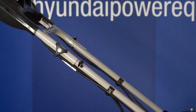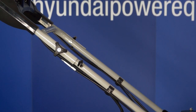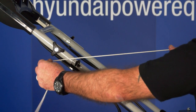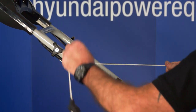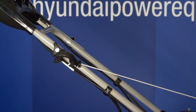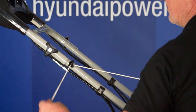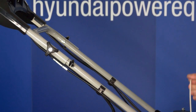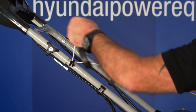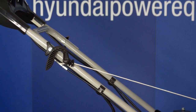Having removed the spark plug cap to avoid inadvertently starting the lawnmower, I'm going to pull out the pull start, tuck the string to the rear of this pigtail, pull it forward and round and locate it in position. That's it in the operator position — across the back, up and round, and simply release it gently back into the machine.